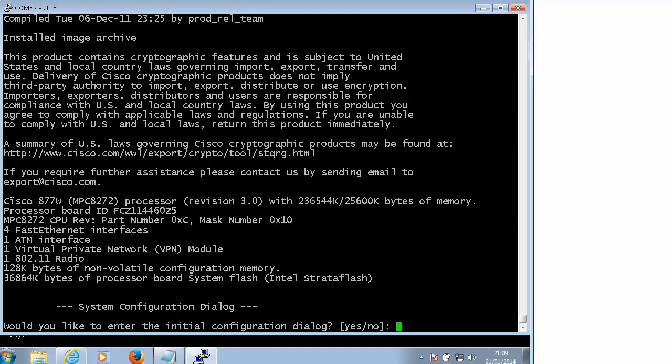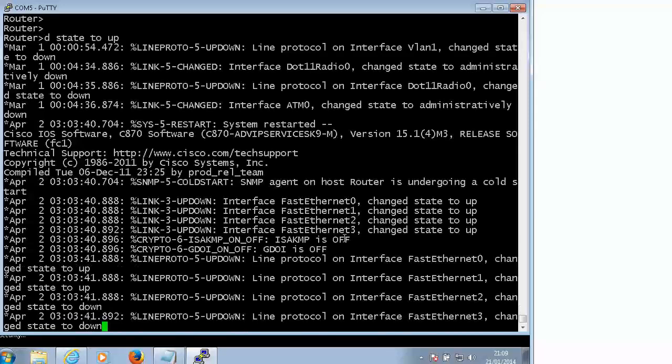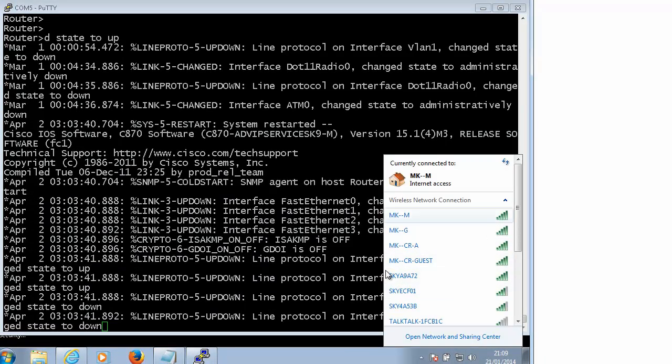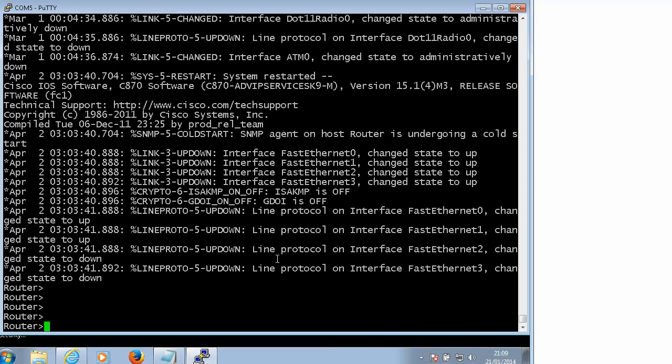So I removed everything from my router - literally there is absolutely nothing on it. This video is going to focus on wireless only, so you can refer to my other videos where I show you how to make the 877 ping the internet. You can combine these two videos. There is absolutely no configuration on it because we will start from scratch. Our goal is to enable wireless on this router, create one SSID, and make sure we can ping this router from my laptop. We want to see a new SSID on the list and receive an IP address from the router, so we enable DHCP.